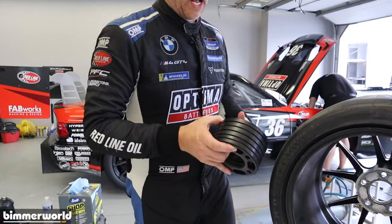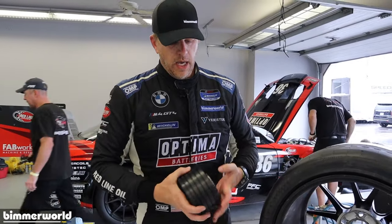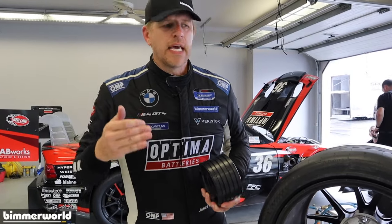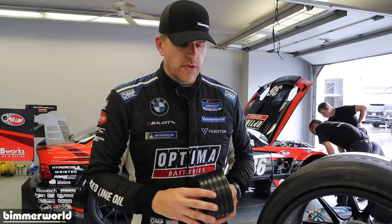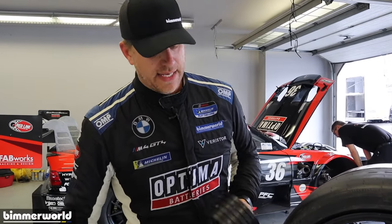And so this is a stack of spacers. This is for our Bergsteiger project. Like a lot of people, we have spacers just laying around. So, we grab a bunch, we accumulate a bunch, all different specs. And again, even different lots, different manufacturers, but even the same manufacturer, different runs of wheel spacers can be different. So that's why you've got to do this paper test every time.